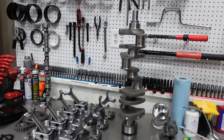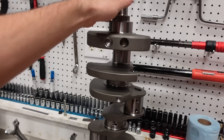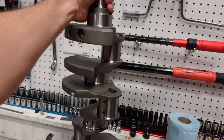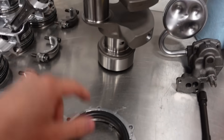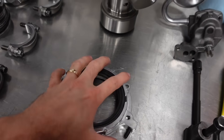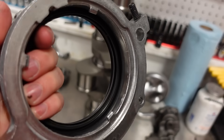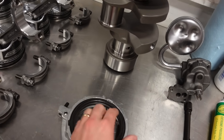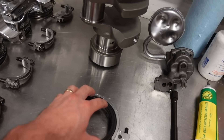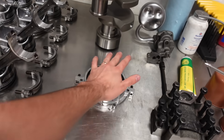The rotating kit for this engine uses our own in-house design Smedding Performance crankshaft. It's a 3.8-inch stroke, 4340 forged hardened steel crank with a one-piece rear main seal. We run a Teflon-style rear main seal — these are really nice. They don't have a spring behind them and are made out of a Teflon-type material. What's interesting about Teflon seals is as they warm up in the engine, they actually shrink and get tighter, so these are virtually leak-proof.